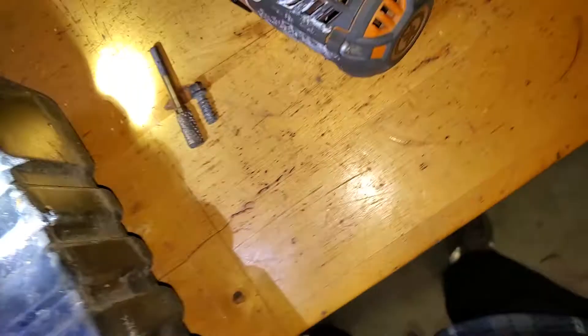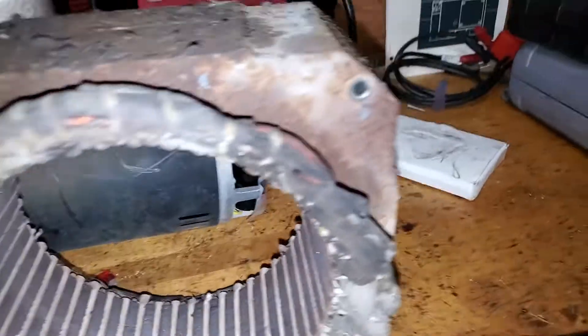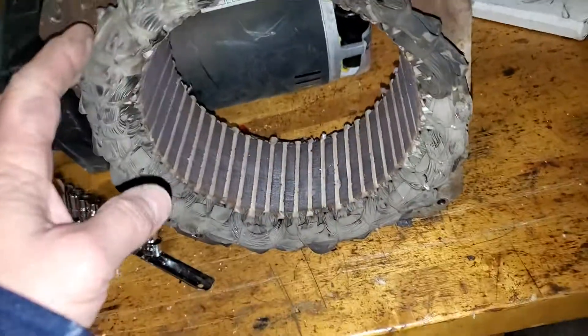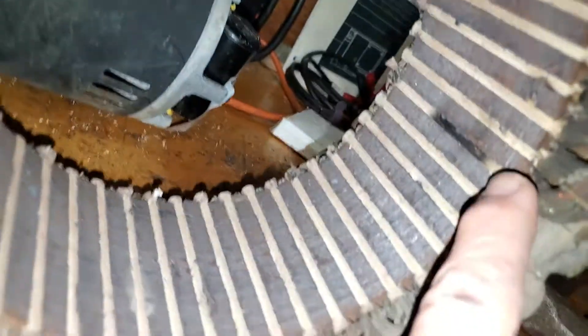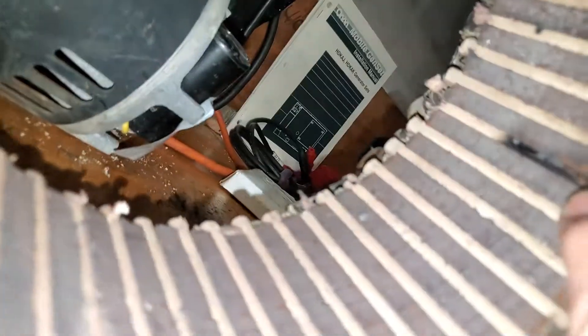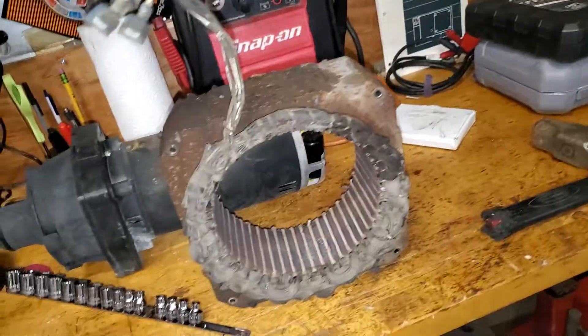It's not that bad — it might be cheaper to get it serviced. Now that was the stator I was talking about where the four bolts are. It's called the stator because it's stationary. When the magnet let go, it hit a couple of windings right here and knocked them — there's a short, a dead short. It happens; it's got 2,600 hours.